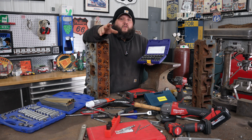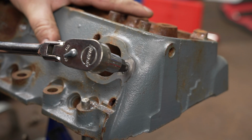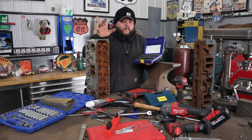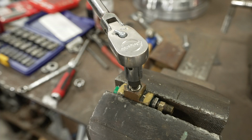Another popular style of extractors are these Irwin Hansens. What I like about them is they're short and stubby. They can fit in tight spots, and they bring all your force closer to where you need it. They're not tapered as much. I've had limited experience with them, but they do work. To me, they really shine in stripped out Allen heads, stuff like that.